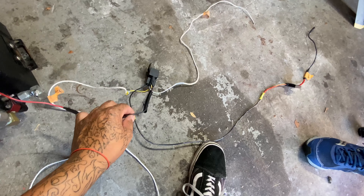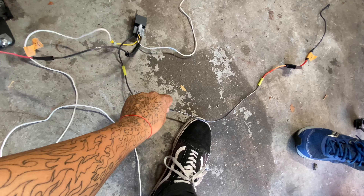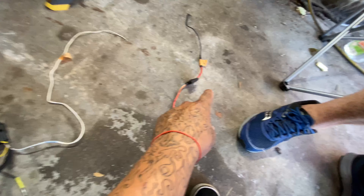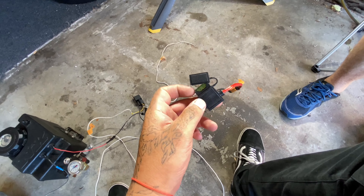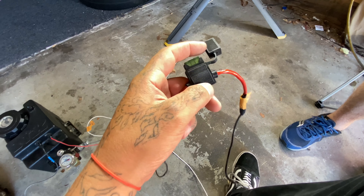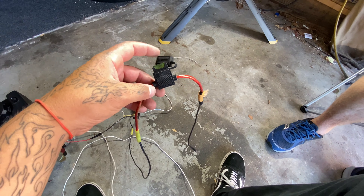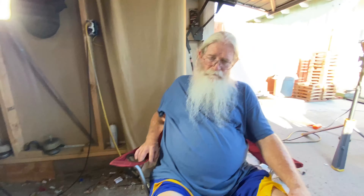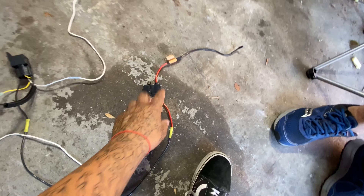Once you mount it you've got to wire it up. Like I said in my previous video, I recommend running a relay with an inline fuse to protect your stuff. If something busts, it's going to pop that fuse and then you can go in and replace it or check the system to see what's going on. This is a lifesaver and they're inexpensive — I bought all these fuses here for about 10 bucks and it came with five of them. Cheap insurance.